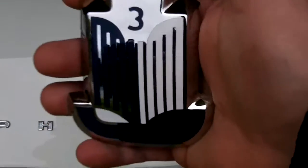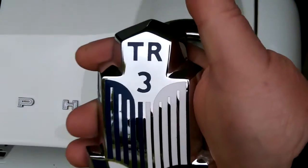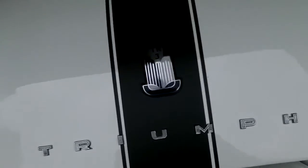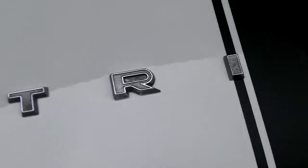This new badge was probably $150, so probably not a wise investment — it's now sitting on my desk as a paperweight. We've made a decision to go with the original, so I'll put the spire nuts on the back of that. Those are what the spire nuts look like — they're slightly larger for this badge. I didn't have spire nuts for the smaller letters, so what I ended up doing was using some white shrink tubing on the back of the letters to keep them in there.